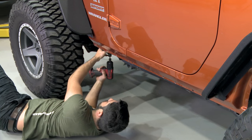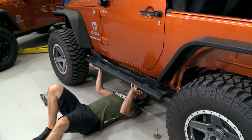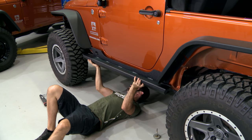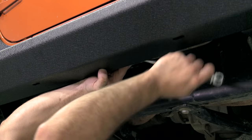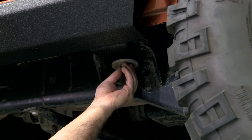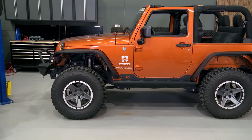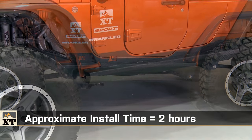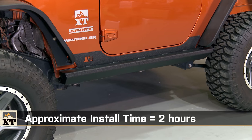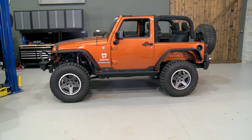Any additional hardware necessary to get them bolted up is included in the box. The first step in the installation is to remove the body bolts from the side of the Jeep you decide to start on. From there, it's just a matter of lifting the rock slider into place and aligning the four studs through the pinch seam in the holes that are already existing from the factory. Start the nuts onto the studs, but don't tighten them down quite yet. After that, reinstall the body bolts with the large washers that accompany them, then go back and torque everything down. That's it — this is a really simple installation. There's no need to take this to a shop. As long as you have a set of traditional hand tools, you can get this done. It may help to have an extra set of hands because these do have a little bit of weight to them, but you can always use a jack stand if you don't have a friend to help.